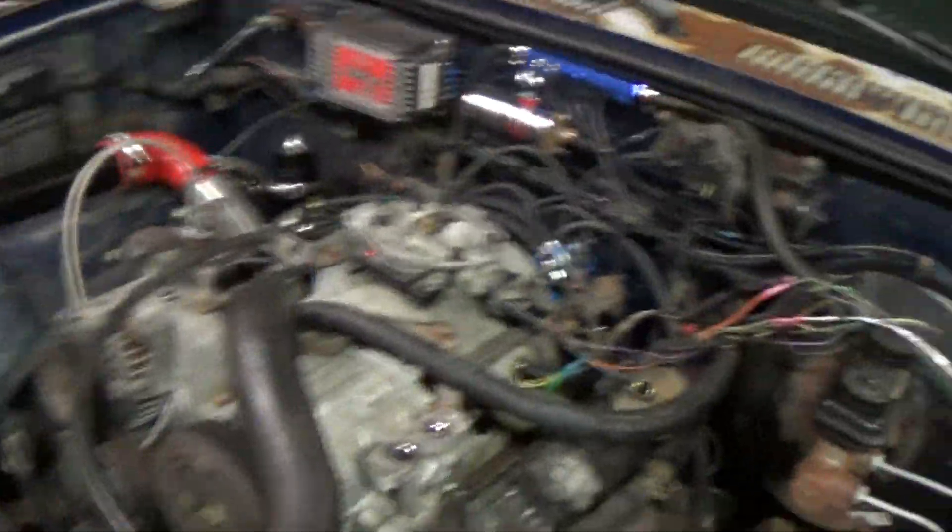Or at least unpin all of the engine stuff from the factory ECU and leave it at that, and then when the five-speed swap happens, remove the rest. Everything else on it works except for the alternator - it was not charging. It's controlled by the ECU. I thought there was a regulator on the alternator but I think it's just some sort of voltage box that translates what the ECU sends. I got the regulator from the Eclipse back in this box.